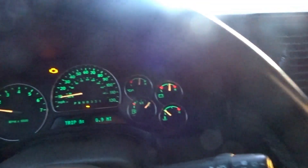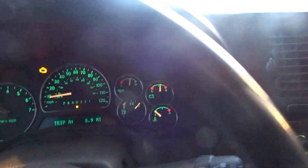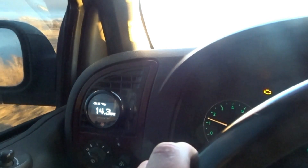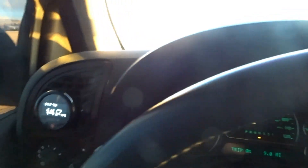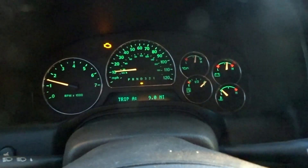After this video, the next one will hopefully be a dyno if I can find an all-wheel-drive dyno around me, and some draggy runs. Air/fuel is good. The max boost I've made so far is 10.6 psi — that pushes quite a bit of boost. For the stock pulley it's not a lot, but it builds boost quick. The supercharger lights up quick and it seems to be really good. Hopefully my fuel economy doesn't suffer too bad because of the gas prices.